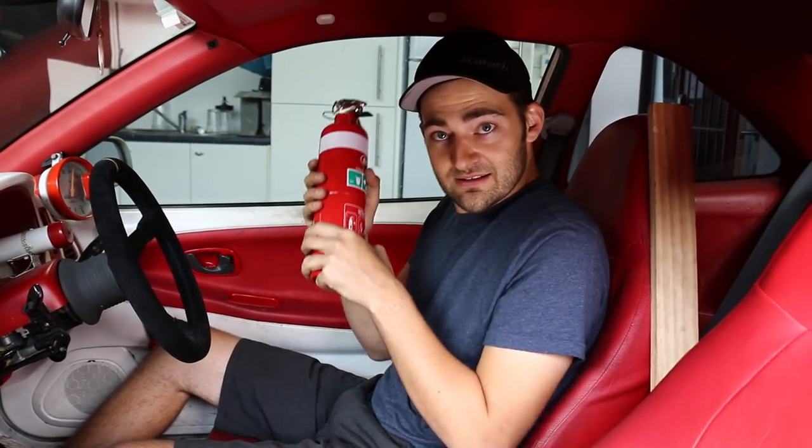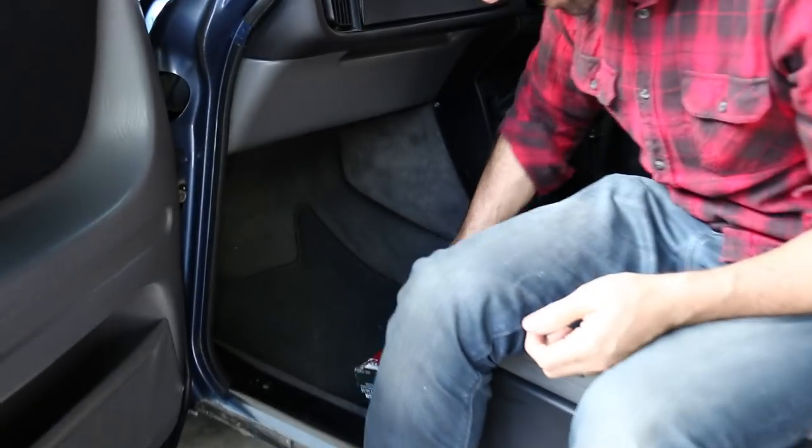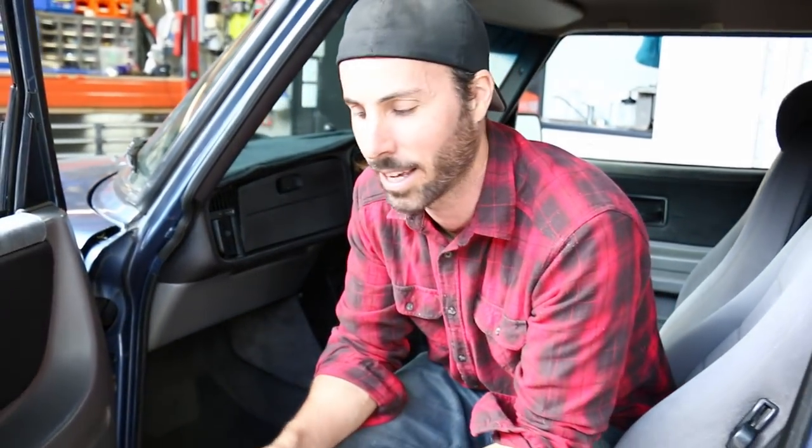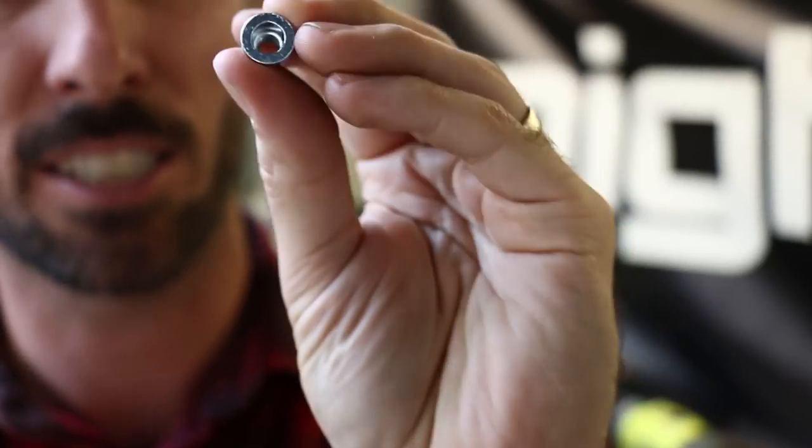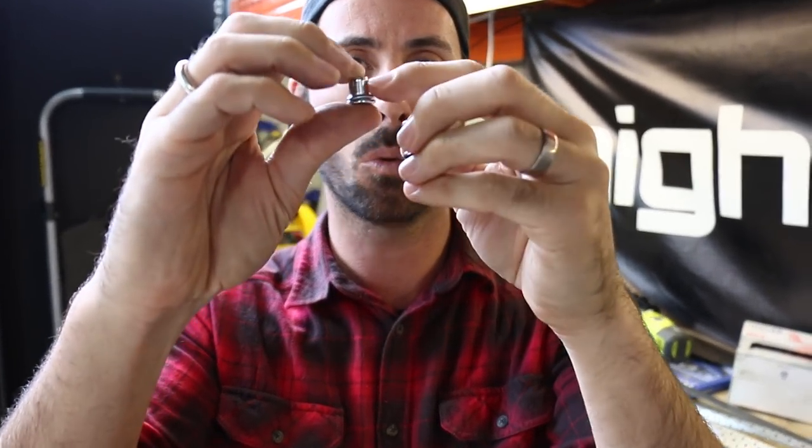That is one way of putting in a fire extinguisher. Now we're going to show you another way on my modified Saab 900 Turbo. I'm going to put mine down here, installed using a rivet nut. This is a rivet nut gun — it works just like a normal rivet gun, except it actually puts thread in, which means you can drill a hole in some part of your car, you don't need to get to the other side, and it'll squash the sheath around, so you can bolt into it without having to access the back.